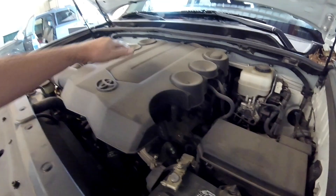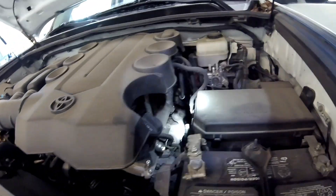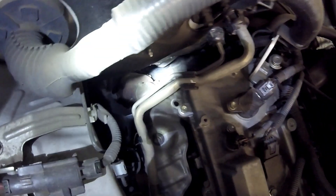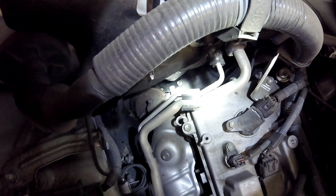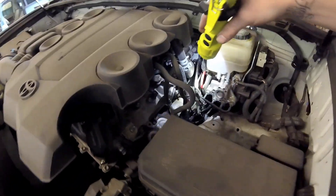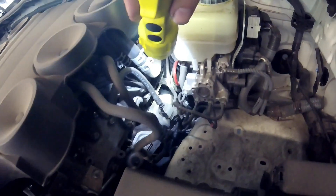Not everything is easy to find when it comes to emissions components — those were the easy ones. We're going to find the oxygen sensors next, and those are going to be a little tough to get to. Your pre-cat oxygen sensors are both right off the exhaust manifold. Here is your bank one sensor one oxygen sensor, or possibly air fuel ratio sensor. Look for a link in the description below to purchase one if needed — hopefully you have some really skinny hands and arms to get in there.